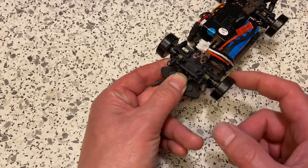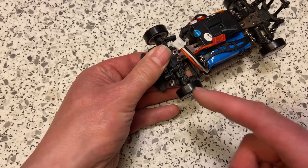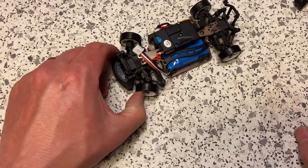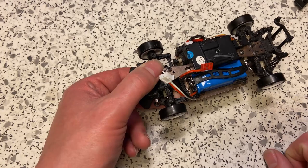So that was my conclusion on this test. And in the next test, we will do the opposite thing. Put a locked diff in the front, an open diff in the rear, and of course, put race wheels on and see how well it races. And why are we going to do that? That's because large 1/10 scale touring cars often come with a locked front diff and an open rear diff. But more on that in the next video.